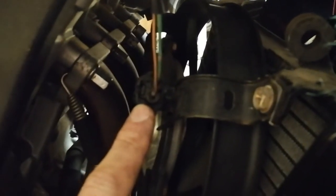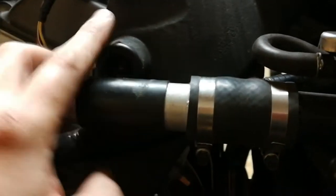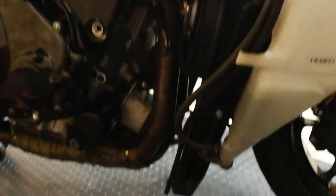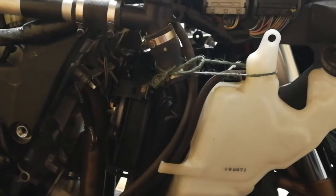The other thing you're going to need to do is remove the radiator fan as well, and then this hose. You can leave everything still attached — it just comes down over this part of the frame, just to give you a little bit of room to get underneath and take off the remaining bolts and screws for the lower airbox. They obviously didn't want you to replace the spark plugs on this bike without taking it to a garage — the whole thing has been designed around this bloody thing. But no, we're cracking on.